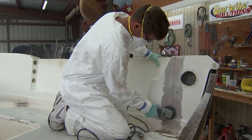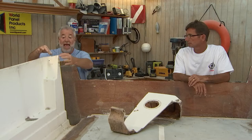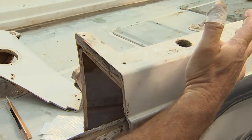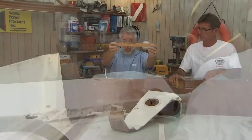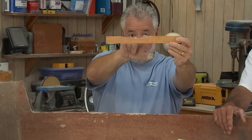It's a half-inch thick up on top. We're looking for a structural repair — 12-to-1, that's six inches. I don't have six inches here, but I can get it here and on this side of the part. I have a little visual demonstration — this is just some wood that I cut a V into.